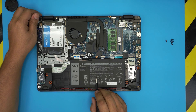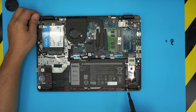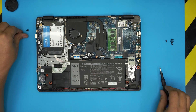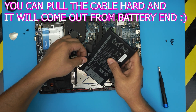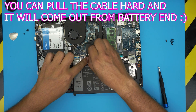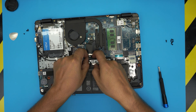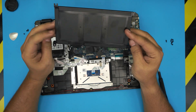I'll try to find a link for this battery. To remove it, take out this screw, this screw, and this screw. Once the screws are out, lift off the battery and bring it back. The connector has a small piece of tape over it — remove the tape, pull it back, put your fingers beside the white jack and slide it back towards the battery to disconnect it.